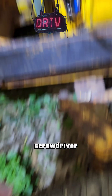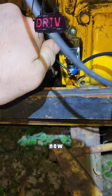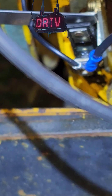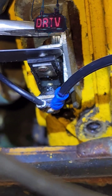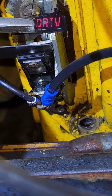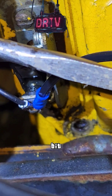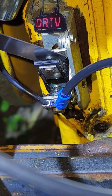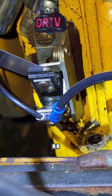Get your screwdriver — flathead. Crack this loose. Now get your feeler gauge in there. Using the screwdriver right where it's at, you can push your points forward. Open the gap just a tiny bit. Right there. There's drag, and there's only a little bit.